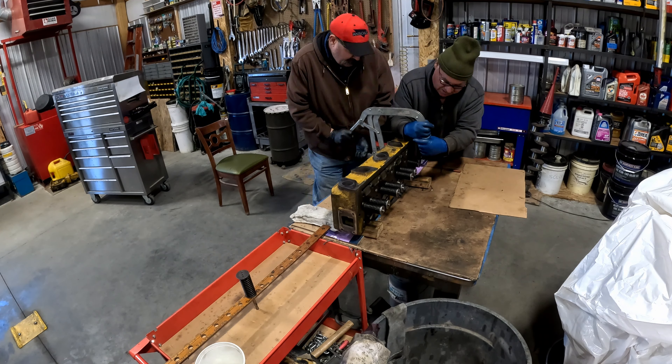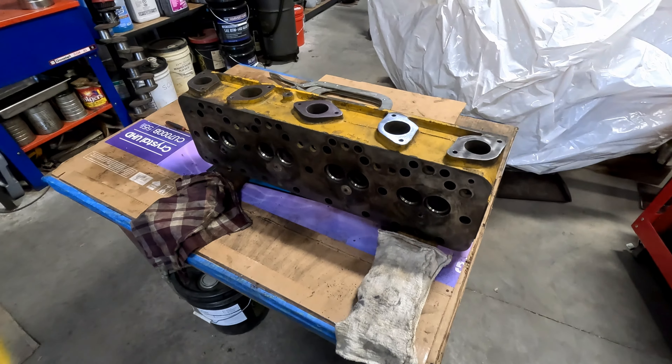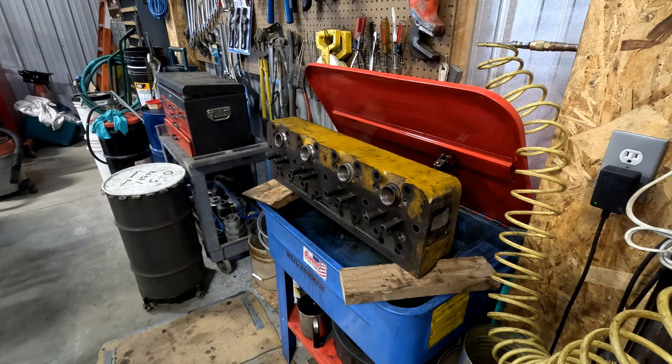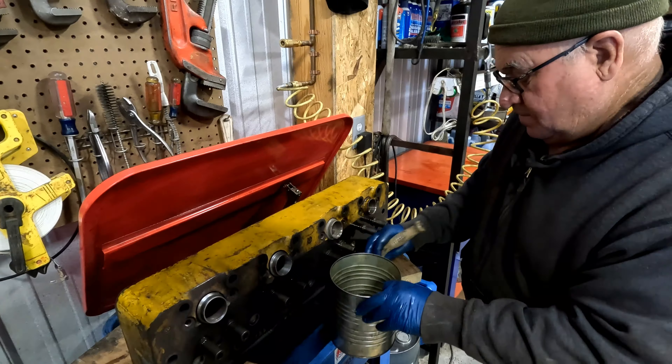I can see debris and dirt in there. We're going to take all the valves out. We've got this yardstick that my granddad picked up years ago to keep track of your valves and guides. We're going to start here - this is number eight. The number one cylinder valves go from the front to the back of the head. In hindsight, when we're not sure we're going to use something, I'm going to go ahead and clean it, needle scale it, get it ready. If it's trash it's trash, but it'll save us from having to redo things like we are right now.